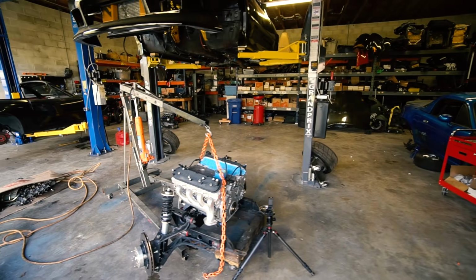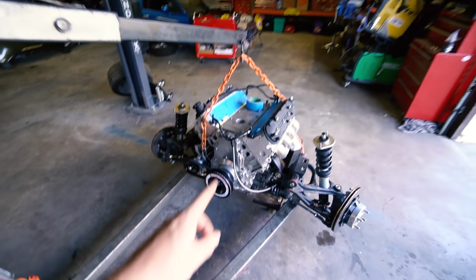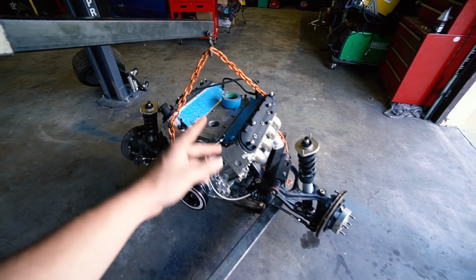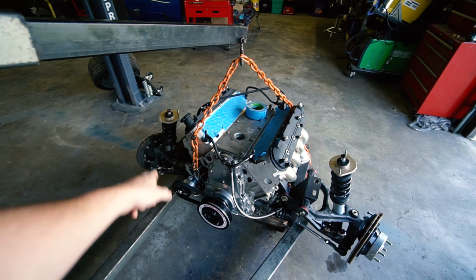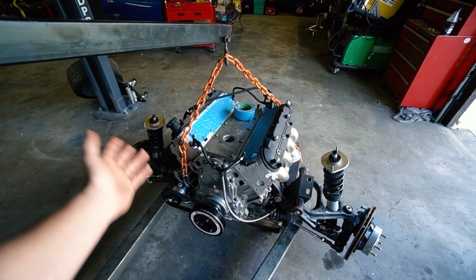When I realized that, I was like, dude, I can't wait another week to work on this thing again. And then I was like, AJ, are you busy tomorrow? Five hours. All right, so yeah, we gotta get to work. I'm letting one of the pilot bushings freeze so that hopefully it'll shrink up some and be easier to install. So for now, I'm gonna go ahead and throw all the accessories on.